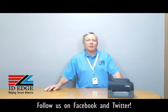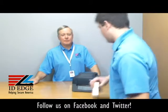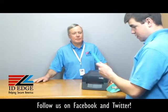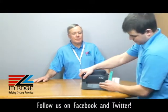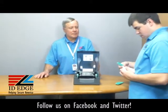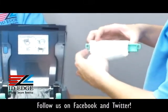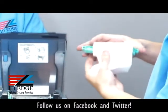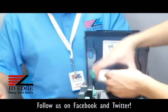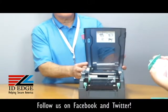To help us with that is Douglas from our tech department. What comes with the printer are these two tabs and this core. You're going to pop open the cover, and with this green core you're going to put the label around it — make sure it goes over the top when you put it in and not under the bottom. Then put these two tabs on and slide it in.